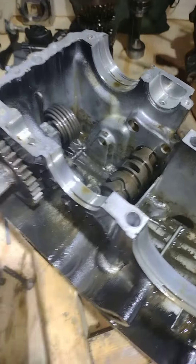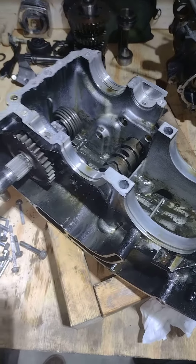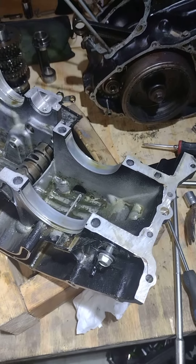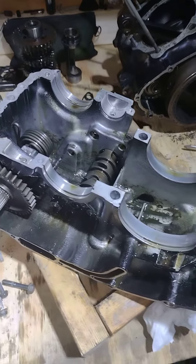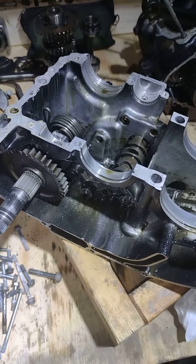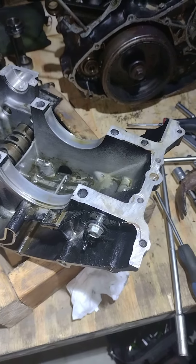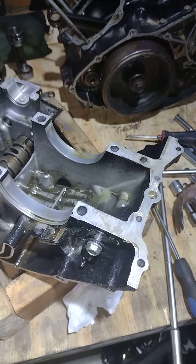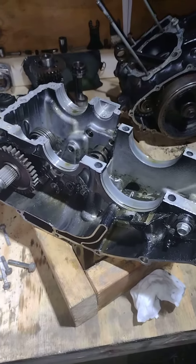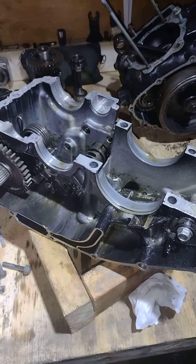These are really cool engines. I like the horizontal split cases instead of vertical, which is much more common. I don't know how many bikes had horizontal split cases like this. The XRs and XLs were horizontal split cases prior to 1983 — maybe some of them were — but they went to the RFVC style engine in 1983, and of course those were vertically split like most engines are.